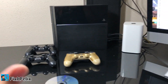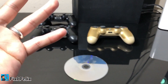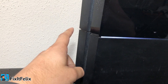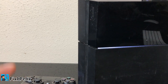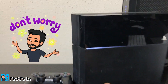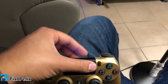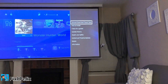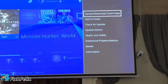So I'm going to show you how to fix it. It's not really fixing, but what we're going to do is make it so the eject button doesn't work anymore so it stops trying to take out the disc. Don't worry though — you can still eject via your settings. Whenever you're on a game, press the Options button and you'll see an option that says 'Remove Disc,' so you can do it from there.